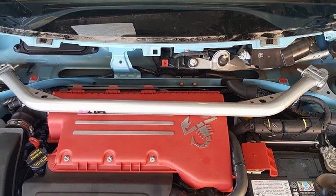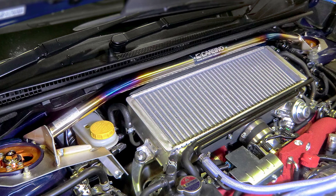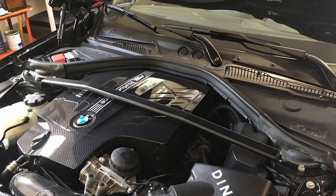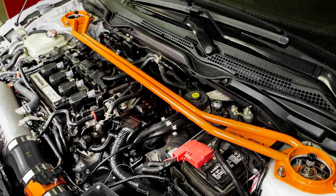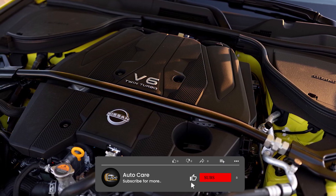Because the body of the car is functionally undamped, it can cause resonance at several frequencies. The lowest frequencies manifest themselves as cowl shake, or general vibration — the actual body of the car ringing like a guitar string until it settles down. High-frequency vibrations generally manifest as cabin noise, which is tuned out with rubber suspension and subframe bushings. Just like tightening a guitar string, making the body stiffer naturally increases the frequencies of those vibrations, putting them in a less perceptible range.